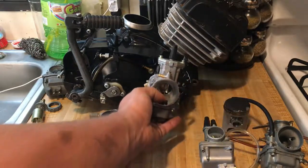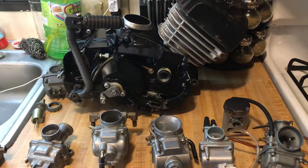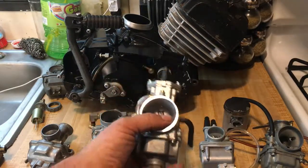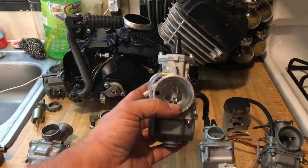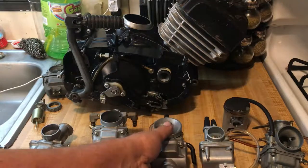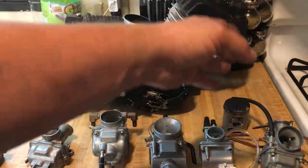I decided on this build I'm going to modify the factory carburetor. You're probably thinking I'm not going to use that cool fancy thing — well, it's not going to fit practically, and I won't be able to use the factory air filter. I've researched carburetors up and down for days. I ordered a carburetor of this style but it hasn't come in. The ones that did come in are just too big and will cause fouling plugs and won't give you the RPM you need.